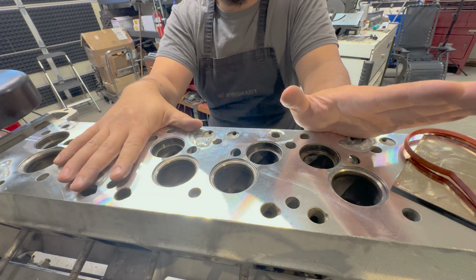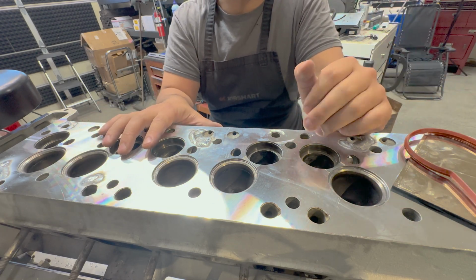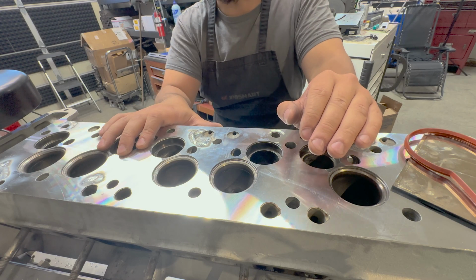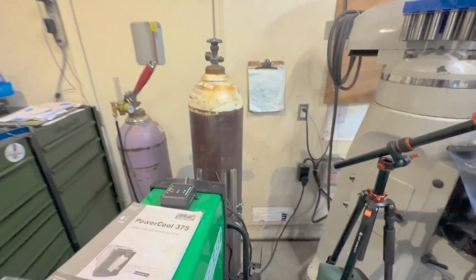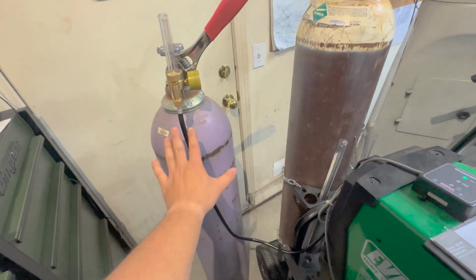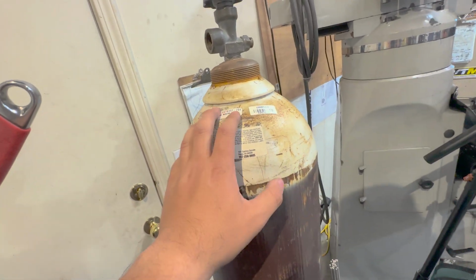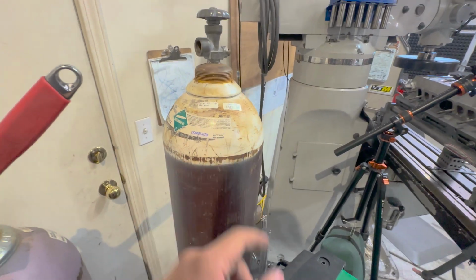And if you've followed me on Instagram, you'll know that I have a real problem with using helium right now, specifically because my K bottle cost me $780 to replace. Let me show you what I got going on. Now, this thing, not approved, it's just sitting there, just ignore that. Assume it's strapped into place. This is 100% argon. Okay, this is getting quite spendy these days, but it's still quite affordable. $180 is what this cost me. 6 years ago, this was $70 to buy.